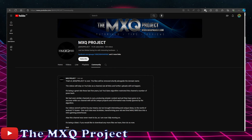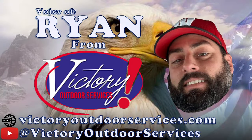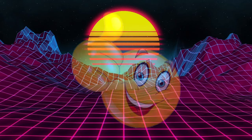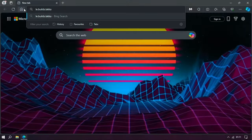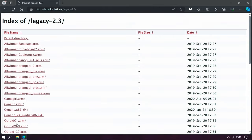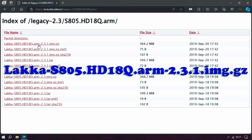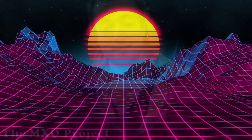The LAKKA developers are sadly no longer in existence, which would make it far too easy for us — we like a challenge. Anywho, getting back on track, we're going to download LAKKA, but we will have to grab an archived version for our MXQ box. We can get it from this amazing archiving resource, and the image file we want is this one: lakka-S805.aarch32-2.3.1.img.gz.